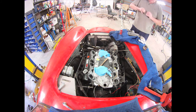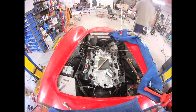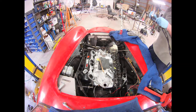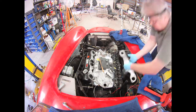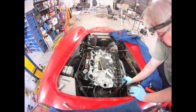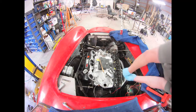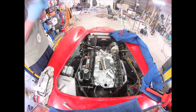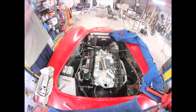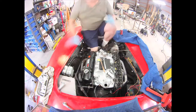There you can see the gaskets I'm reusing, which I probably shouldn't. It wouldn't be too hard to put new ones in — just unbolt the headers, slip new ones in. If I have leaks in the future, I'll address it. I'm using an exhaust sealant on either side of the gasket, very thin. I do use never-seize — the gray never-seize paste — on the exhaust bolts especially, having dealt with a lot of rusty fasteners.